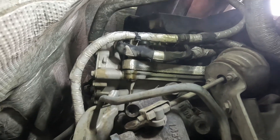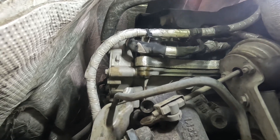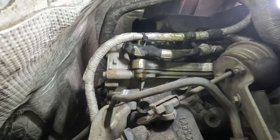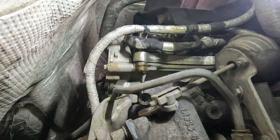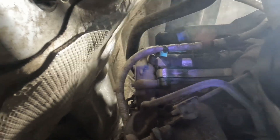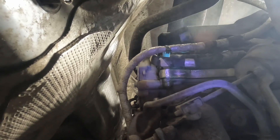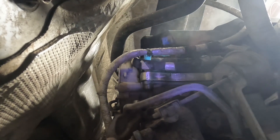The mic wasn't on while I was recording, but as you can see there's smoke from the bad oil leak at the corner of the valve cover gasket. It's pretty bad — it's going onto the exhaust manifold and creating a lot of smoke. With the UV light on it, the camera is picking it up as a lime green color, but as I showed you earlier it's actually a bright orange. Good thing I found the leak — let's go ahead and get a new valve cover gasket and replace that.